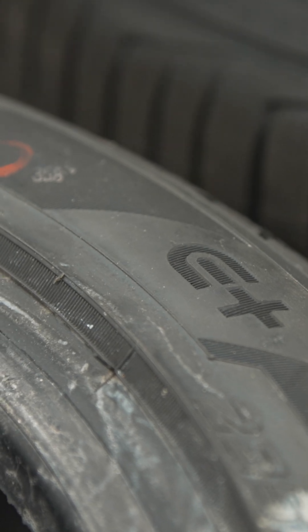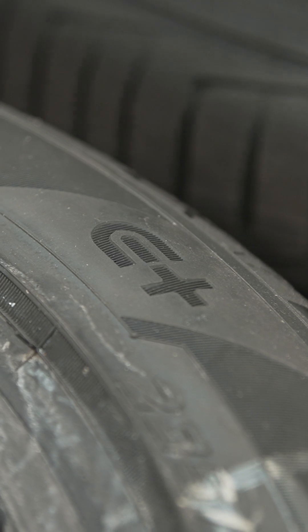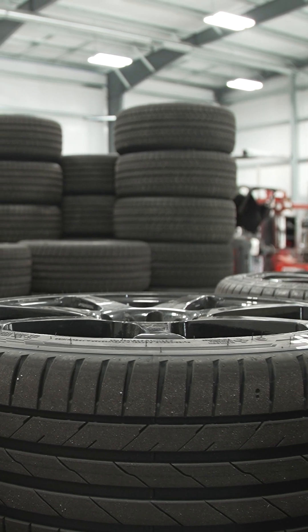The OE tire was the most efficient tire though. It had less tread depth from the factory, brand new, which is a way that you can reduce mass in the tire and keep it low rolling resistance. They are doing things to make them more quiet — they put foam inside of them. That tire, however, suffered a little bit in winter traction. Our testing just didn't show that overwhelming change against a regular all-season tire.